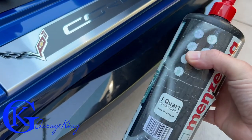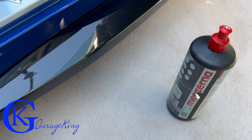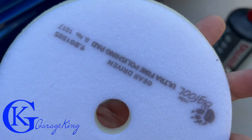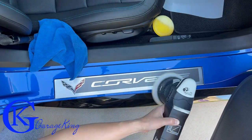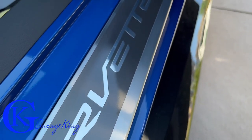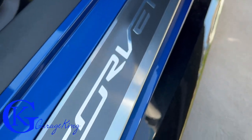We're going to give it a little electronic polish job. I have the Menzerna Just a Fast Gloss — it was a 400, not sure what it's been replaced with — and then I have a Rupes ultra fine finishing pad. We did a buff there and it looks really good. Very pleased with that — it did take out the slight scuffing.